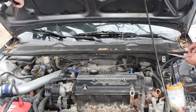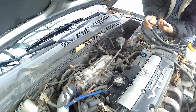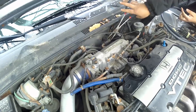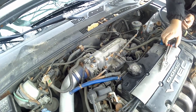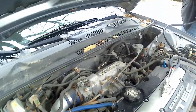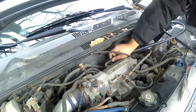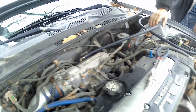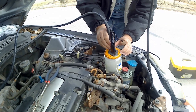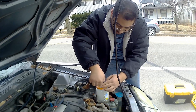So basically what I'm thinking here — this is the brake booster. A lot of people will hook it up to this hose here, but I don't have the right end fitting. So basically what I'll do is take it from here — I already started loosening it up. Using a plier, just take that thing off and wiggle it around. There we go. Let's see if my choice of hose was correct — yep, this should fit right in here. Once we fit this in, we hook this up to the outlet. Using the pump, we'll inject air at the inlet.